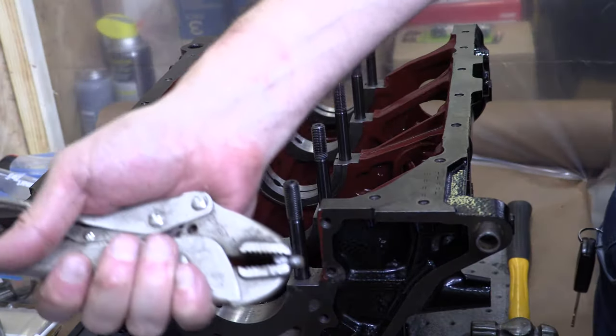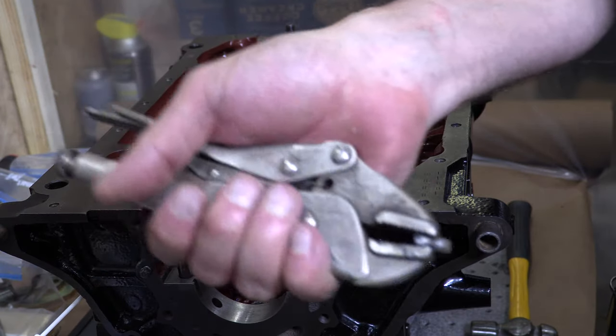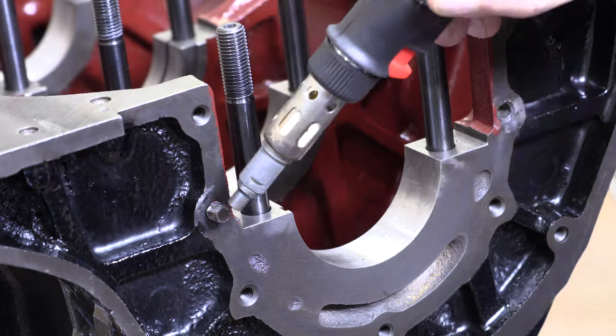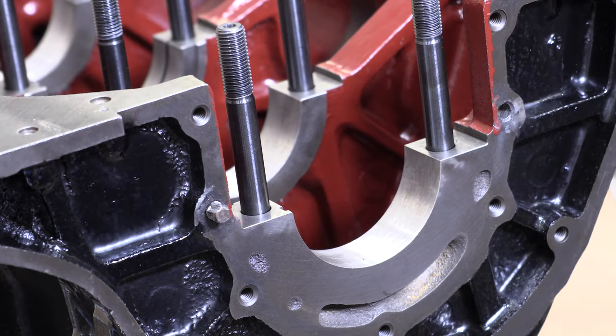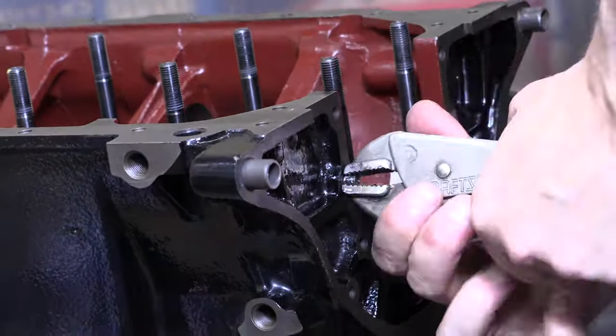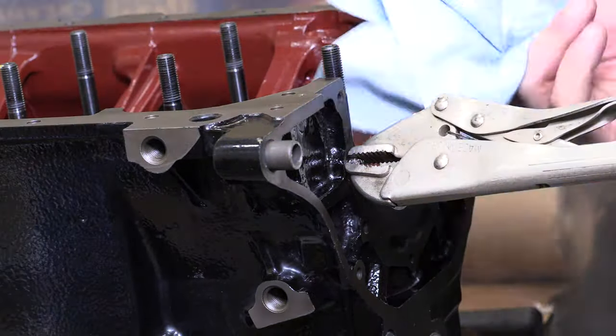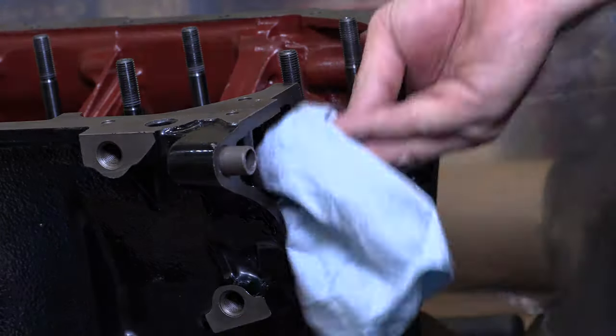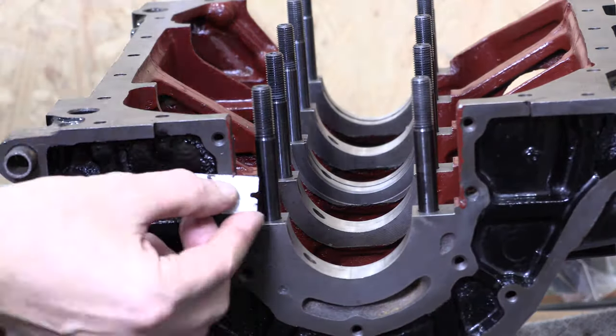It'll be hard to spot, but after I heated up the pin, I shot it with an upside down can of air to freeze it. This temperature shock seemed to do the trick, but it didn't work for the other plug, which gave me an indescribable kind of fit that even required getting my feet involved. I felt that one in my left shoulder for a couple days afterwards. Good times. But there you go, with those out of the way, a gasket goes here, so clean it with a razor blade.